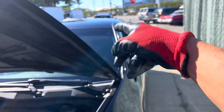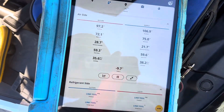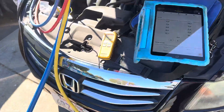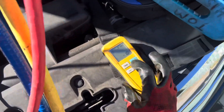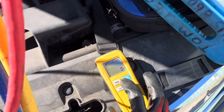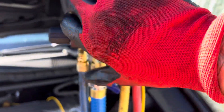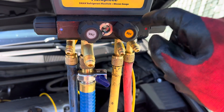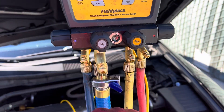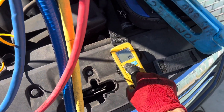The windows are down on both sides, it's 106 degrees inside, 96-97 degrees outside. Time to charge — zeroing out to 450 grams. Vacuum is off. Liquid refrigerant is sitting right here, suction is closed, liquid is open on the high side.